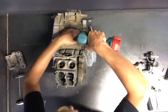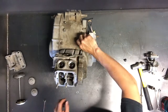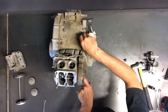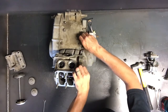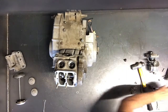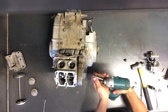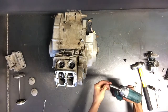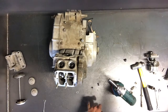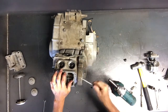Use a 17mm socket to loosen that whole thing up. To tighten it, there's a flat head screw — you just run that in until it's the tightness that you want it. But back it off right now, that way there's not as much tension on that tensioner. Then take a 10mm socket and it'll take out the two sprocket bolts.